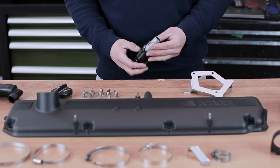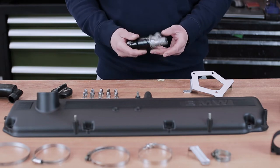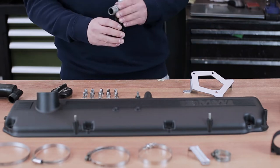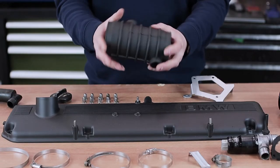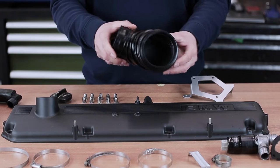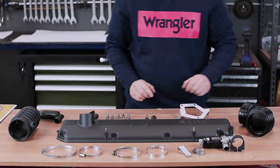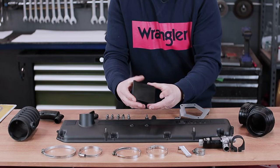There is the step motor — it helps to idle the car when cold. Once it's stuck it doesn't do its job. That one was stuck after 35 years of use; the car is from 1987. After we cleaned it with some brake cleaner it started moving again. The intake hose has been coated — it was still in good condition, rubber not cracked and still soft, so we decided to just restore it a little bit. The clamps are BMW OEM clamps; we cleaned and resprayed them. One cracked piece was fixed and painted, and this cover was just cleaned.